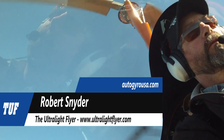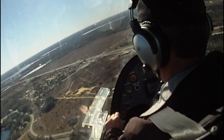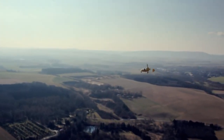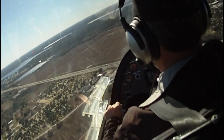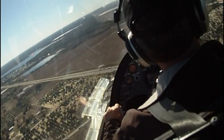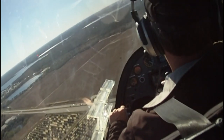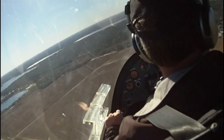One thing that people observe is that the gyro handles wind conditions better than most flying machines. We've effectively got a 27-foot diameter wing, but we're a fairly short span. The actual wing is only about eight inches in chord. So it kind of chops up the thermal to begin with — you've got high wing loading. That's what makes it so stable.